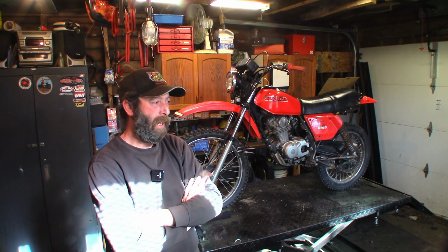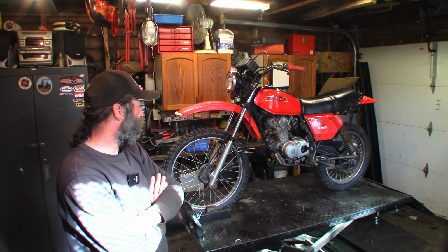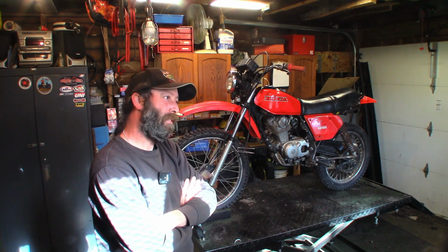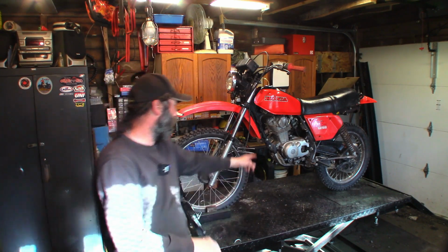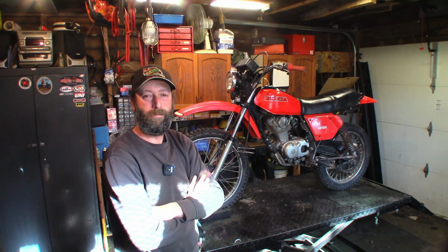But we're gonna do a valve set this morning. Just tinker here and there. I mean, they took care of it. It's well maintained. We're just gonna set the valves because I don't think he's ever done it. It's got to be done when the engine's cold. I haven't fired it up today, so it's cold in here. Furnace is firing up right now, so let me get some tools gathered, and we're gonna pull the seat off, the gas tank off, to get to the intake side adjuster port. The exhaust side is right here. Great big plugs, easy to get to, but it's not quite easy to get the feeler blade in there. But we'll get started on it anyways, and we'll see how it goes.